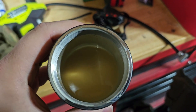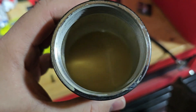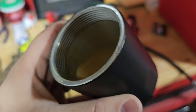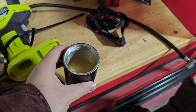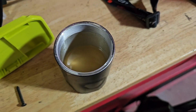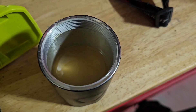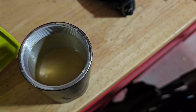Alright guys, this is after a thousand miles. I went on a highway trip most of the time and this just caught — it looks like oil, looks pretty finely watered. I don't know if it could be a mixture of fuel. This is a six-ounce canister, going 75 miles per hour most of the time, maybe 80, and this is how much it's caught already. It's milky looking, so it definitely did something. Think about that — that would be going right back over my intakes.